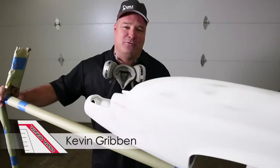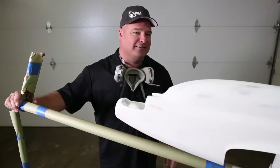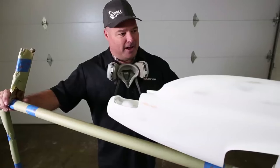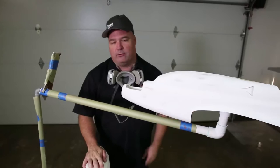For all of you that have watched it on the internet, here it is — it's time to paint today. The airplane is prepped: sanded down from quarter inch to 3/16s on the fuselage side, glassed in 0.6 cloth with West System MGS epoxy, primed with two coats of catalyzed primer, and prepped out with 320 wet. At this point it's time to start spraying.